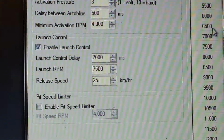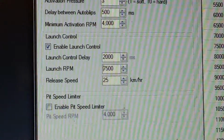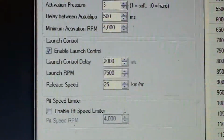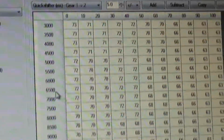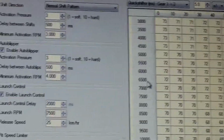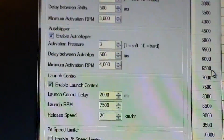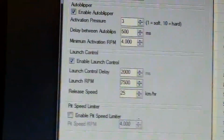So we're going to set that up and enable all that. We then have to reflash this into the ECU. We've got your original fuel map that we wrote for you in there, so we really don't need to go back on the dyno again. It's just a matter of flashing that in there and going for a test ride to make sure all that works. If you were sussing anything, you could rerun on the dyno again to make sure the map was the same, but it will be fine.